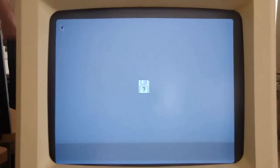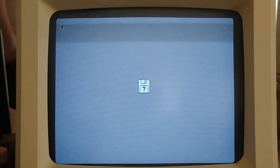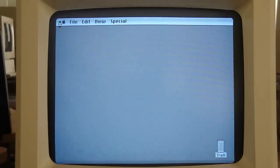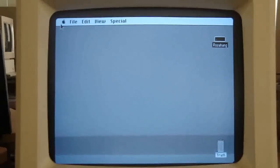With the analog board installed, let's turn the computer on. I'll flip the switch on the hard drive, give it a few seconds to start up, then flip the switch on the computer. To my surprise — I didn't realize this until this morning — the 128k motherboard was actually upgraded to a 512k, so I didn't even need to swap the analog boards. But still, it is a 128 computer case, and whatever's inside it is working, so that's good enough for me.